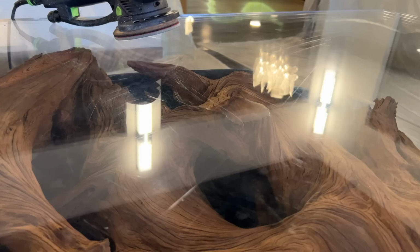PPF is a paint protection film that you normally would see on a car. They apply it to the front, or a lot of people like to call it a clear bra. But first we had to get it back to where it was 2 weeks ago with zero scratches. So I started down at 1000 grit, got all the big scratches out and progressed up to about 3000. I was able to repolish it to a stage 2. I didn't put a sealant on it because the PPF wouldn't have adhered properly. And then I brought in the guys the same day to install this coating.